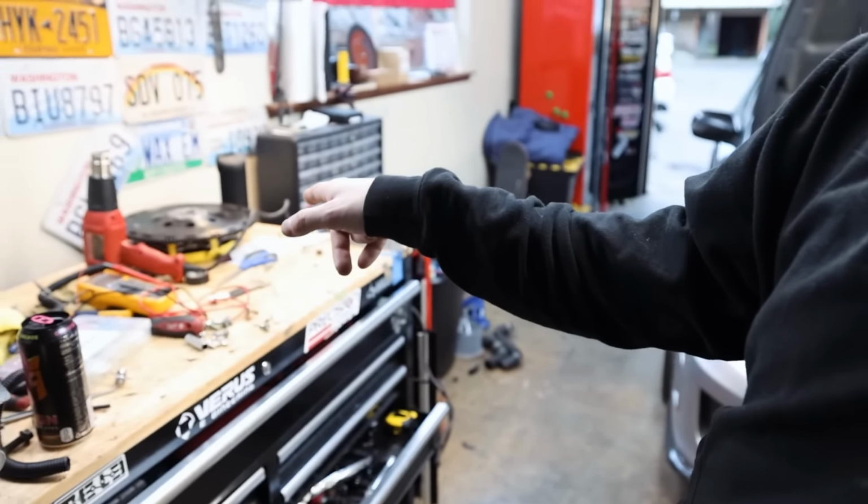I shouldn't have tried to reuse the clutch. I genuinely thought the clutch would be okay to reuse. I don't know what about that clutch assembly is screwed, but something about that clutch assembly will not allow you to go into gear. And we tried two or three times with that old ACT mod twin that I have over here. And then we bought that new one, put that new one in, and it worked right away.